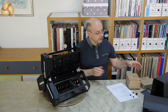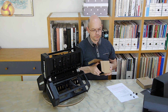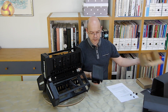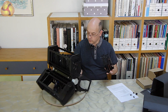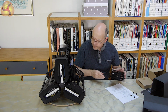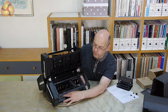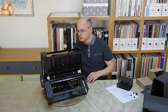One other thing worthy of note before we get further into this: in the box of accessories, packed in very tightly actually, is a drive caddy. There we go, which goes in here at the front. This rail removes, the caddy goes in. Once you have the mini ITX motherboard mounted here, leaving the front empty, you can, if you choose, actually put a 120 liquid cooling system on those mounts instead of the drive caddy. So you can have your motherboard there and your liquid cooler there, which strikes me as quite interesting.